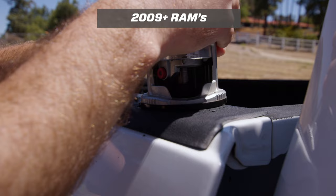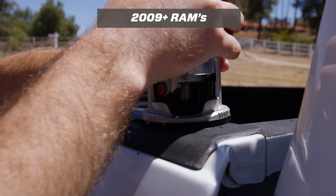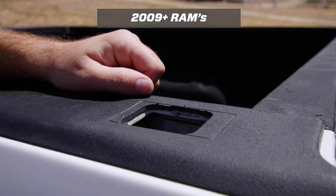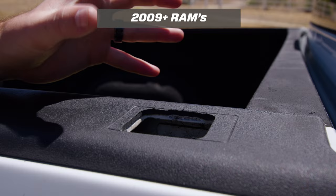After you've made your first cut, go around one or two more times to get any excess or slag on the sides off. Make sure you have your router bit at the right height, just enough so it's cutting away the plastic. If you have it too low, it's going to rub against and start to eat out the metal — you'll feel that vibration hitting up against it. So stop and readjust to the right height.